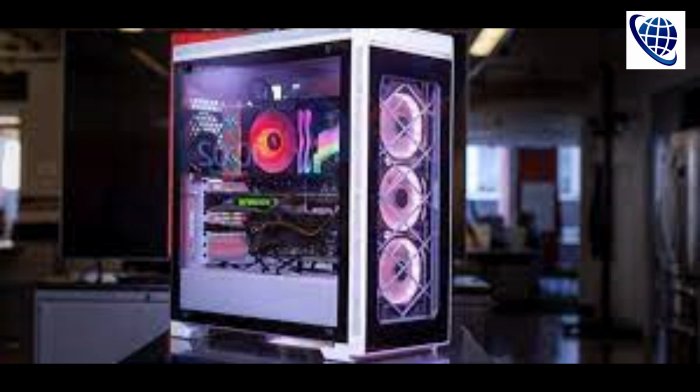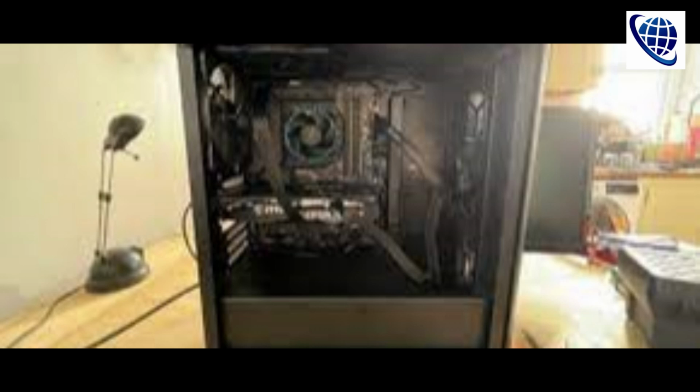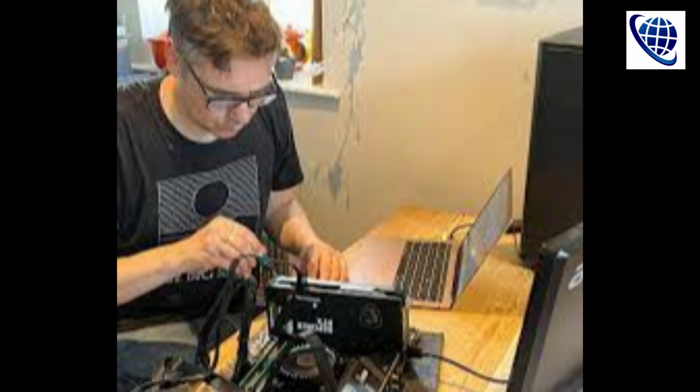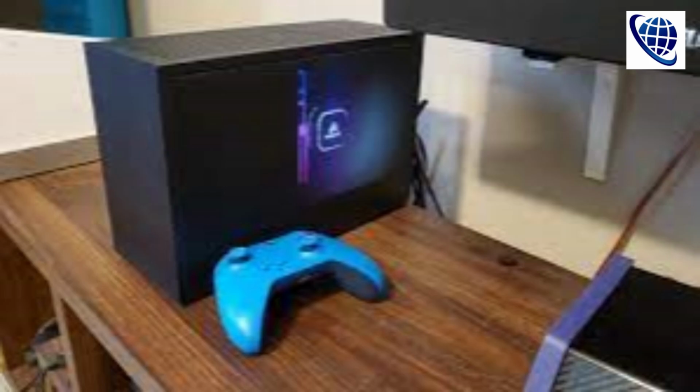Most experts I spoke to said it's better to aim for balanced performance, with your GPU, graphics processing unit, and CPU, central processing unit, comparable in price and abilities. That way there are no bottlenecks in your system. I'd say for a budget machine you should be aiming for specs that can handle 1080p screen resolution and 60 to 144 Hz refresh rate.